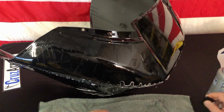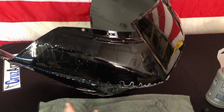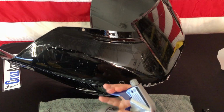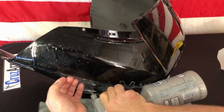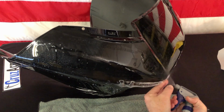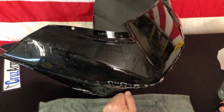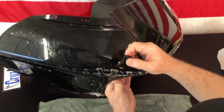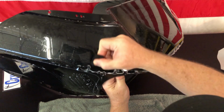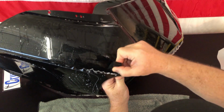Okay. So now pretty much all the flat surface is done. Now the thing is you have these little fingers along the edge. So we're going to go back to the alcohol mixture, okay? Anywhere on this lower edge that you have those, you're just going to spray some of the alcohol. We'll work on this section first. Again, that alcohol is going to wash out the soap and allow the adhesive to tack to the fairings. And then you just slowly push those out. Where there's a big one, when you push it, you'll see it turns into kind of smaller ones.